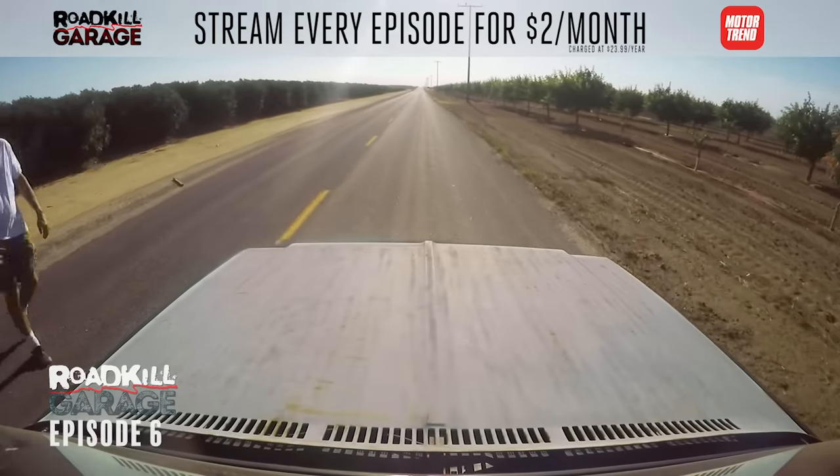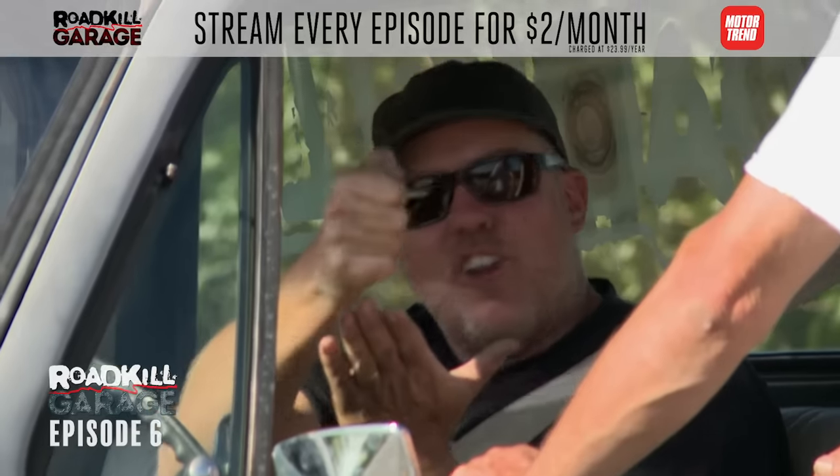Overall, equivalent distance with more tire smoke but not as much flare. I matched the distance — about the same. I had to keep it just off the rev limiter and modulate it before I shifted. Once those radials get hot like that they become ball bearings, but it went about the same distance. I actually learned something: it doesn't have the torque to keep it going. Still, between two telephone-pole lengths — about 220 yards, roughly 660 feet. Pretty good.